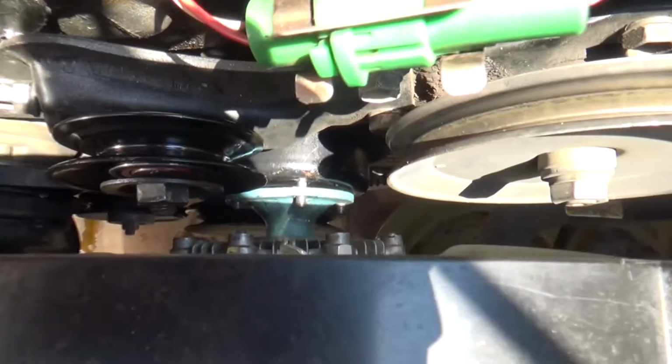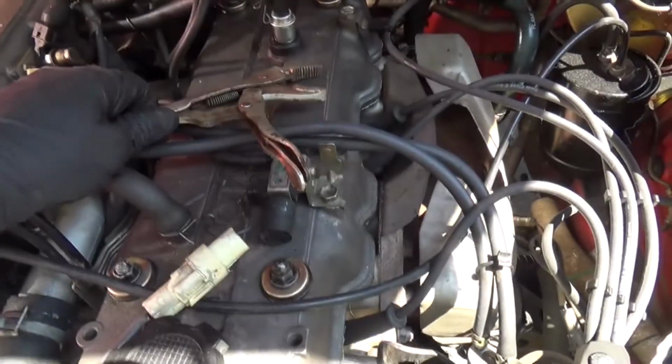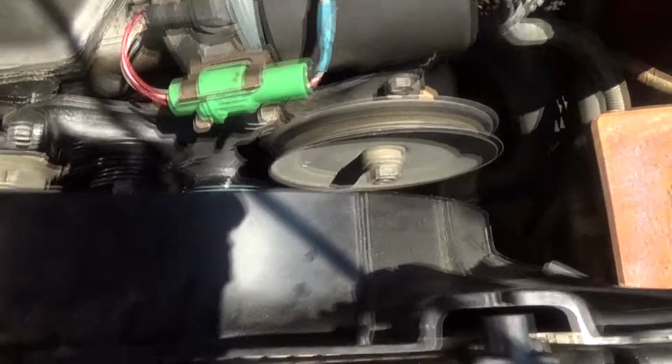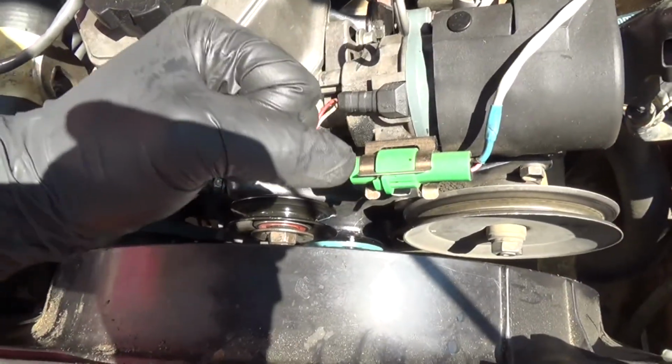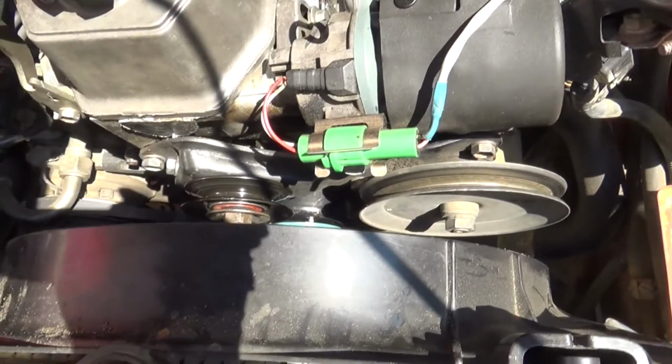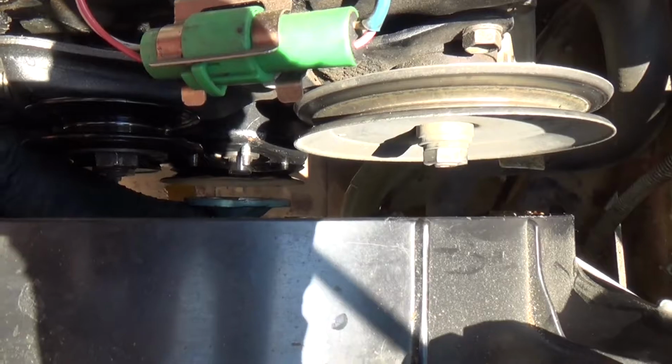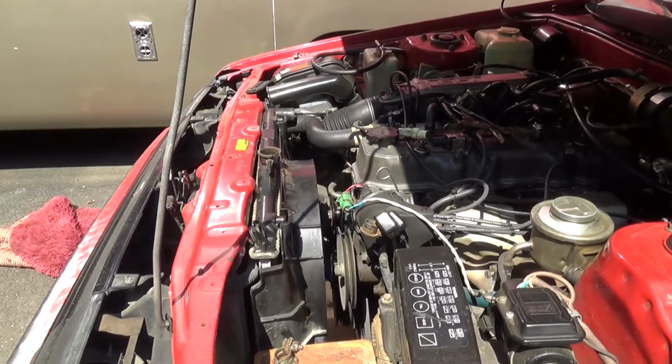I did this by taking a pair of vice grips. I grabbed the middle, that blue stem, so that it wouldn't turn, and then using a 10mm wrench, I just cracked each loose. Then I put a flathead in between the 2 faces, and tapped it a little bit with a hammer, and I got it to split off. So our fan is now disconnected, and we can pull the radiator out.